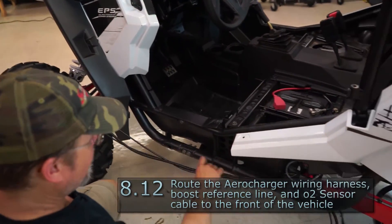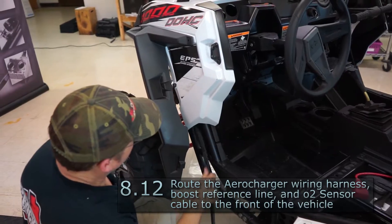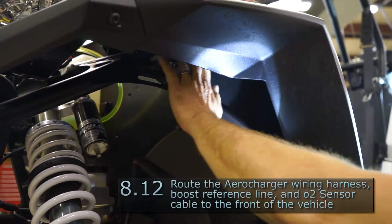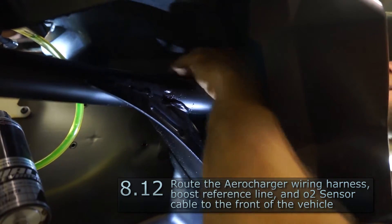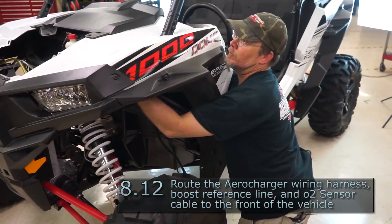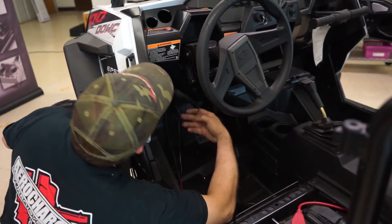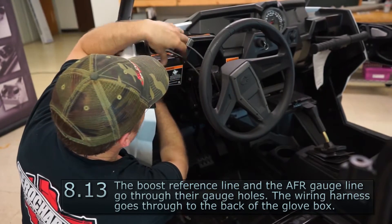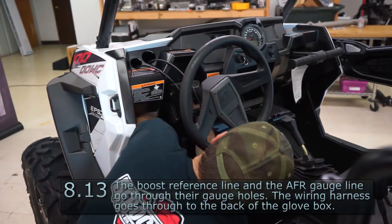Run along the bottom of the chassis and come up through this white panel. Follow the frame rail up to where the roll cage attaches — there's a hole that leads into the passenger compartment right on the top side of the roll cage attachment to the frame. Reach down in here and pull it into the cabin. This line comes through for your AFR gauge, this one for your boost gauge. The cabling for the fuel controller goes over the top of the steering column and into the hole in the glove box.